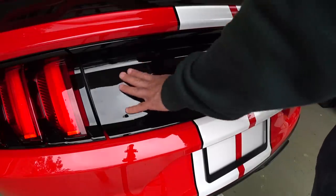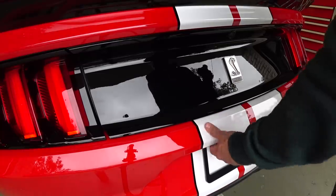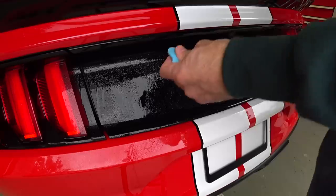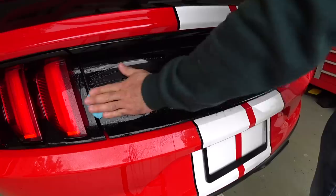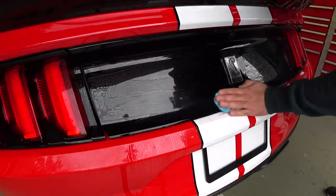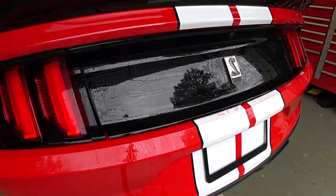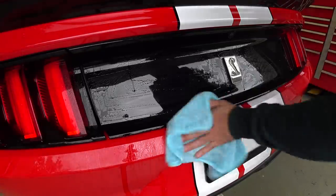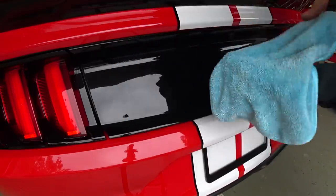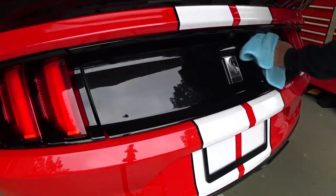We're going to protect the lower bumper, mask off the upper edge, and mask off the emblem. Let me get the Meguiar's Professional Clay and liberally spray the 007 Gloss Enhancer as lubricant. You don't want to put too much pressure — you don't want to mar the surface, just go nice and easy. You can start to feel the resistance change as you're doing this. Always check your panel and your clay as you go. That's pretty much done — give it a good wipe with a Griot's PFM Detailing Towel. These blue ones are great; the size makes it a lot easier because a towel that's too large can get snagged on emblems.